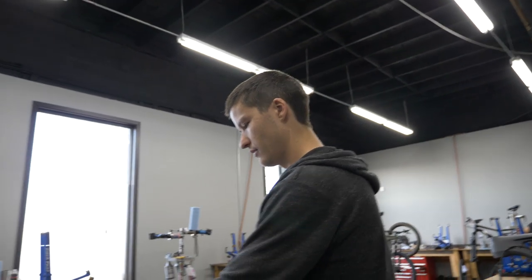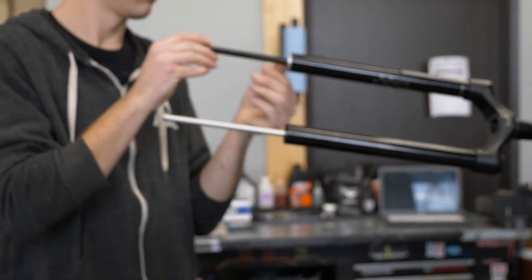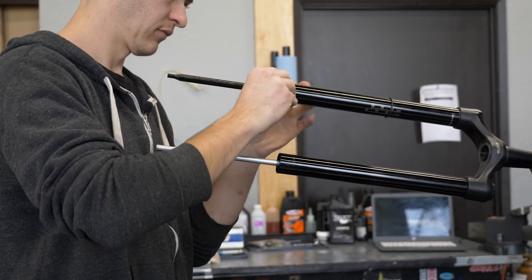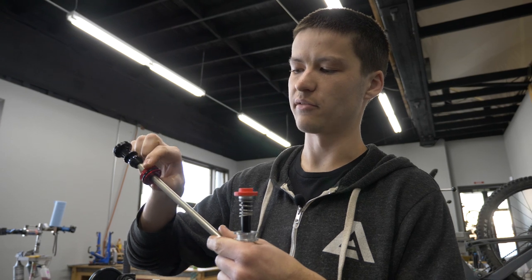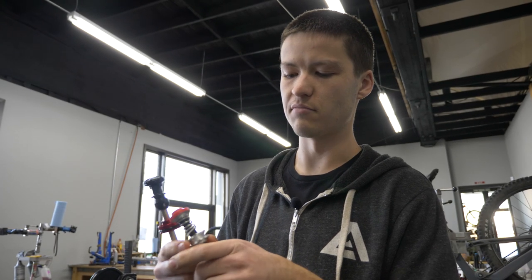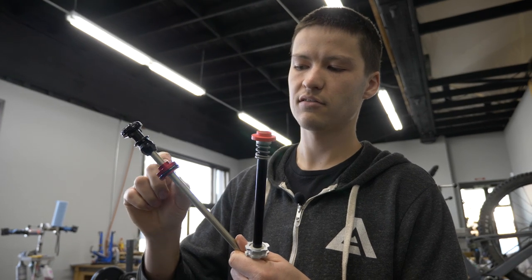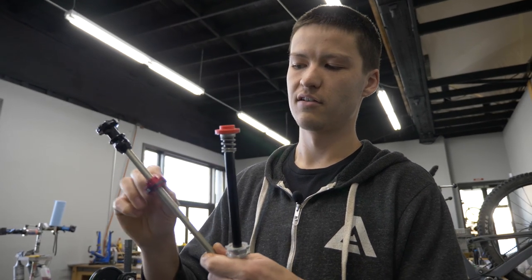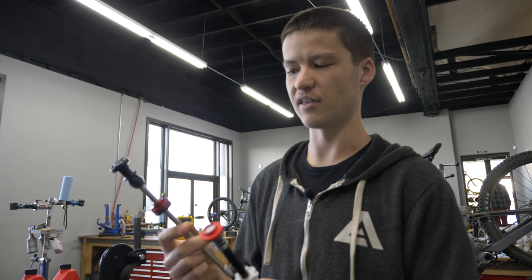And what does that effectively do — reduces friction? Yeah, so you're gonna have a lot less friction. Anytime you have more seals, you're gonna have friction involved with any moving seal. This bottom seal doesn't move, so there's no friction there. Really you're only getting it from this top seal and the seal inside of this red piece against the shaft. Same thing with this one — you can see that this red piece does not move as easily as this one. This one just falls on there and this one doesn't. So there's a lot less friction in this system, whereas the air spring, because it has some seals and it's sealing in air, does have some more friction.